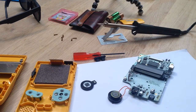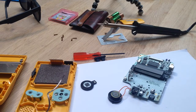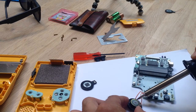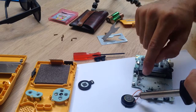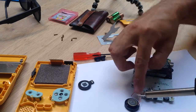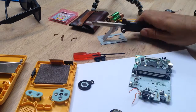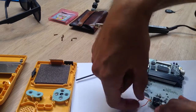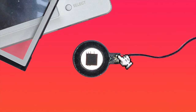It's time to heat up the soldering iron. Let's unsolder the speaker. Once your iron is hot, place the tip of the iron on these points of contact. The speaker will detach from the wires. Now grab your DS Lite speaker and get ready to solder. With your iron, attach this wire to this point and this wire to this point.